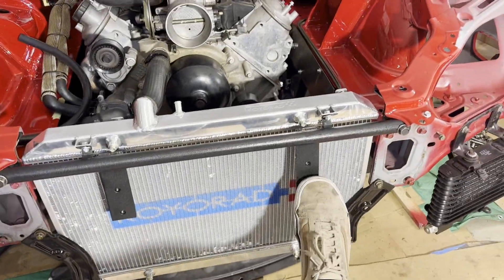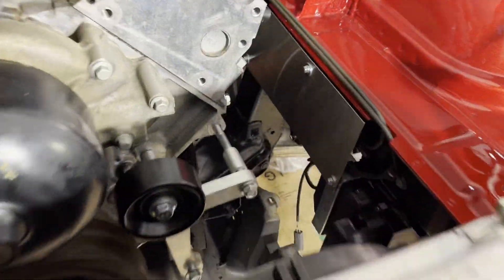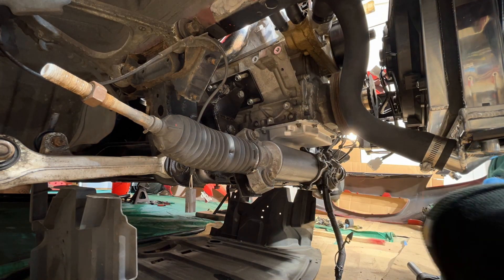We got some extra mounts there for something else that I'm hoping will be in one of the next couple of videos. As we're finally assembling everything and wrapping it up, this is the final install so everything's going in. One last thing I'm going to do for this video is put in this steering rack — I really should have put that in before I got the radiator in but there should still be plenty of room underneath to get it in. I do have the bump steer kit for the steering rack — Steven's kit from LS1RX8 — so that'll be nice and easy to install whenever the time comes. I don't want to install that right away because I might be doing some modifications to the knuckles, so we'll see if I end up installing that or working on those knuckles before I drop the car down.